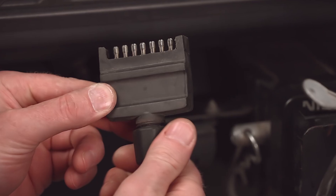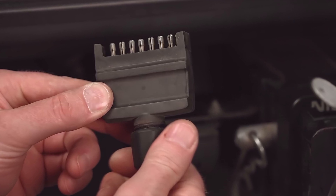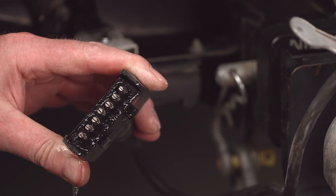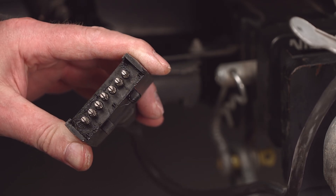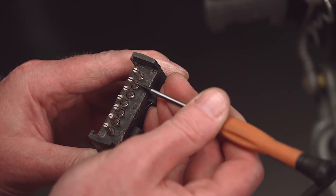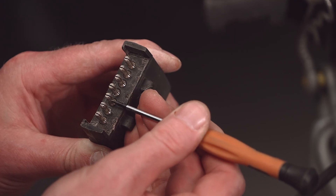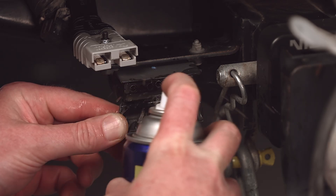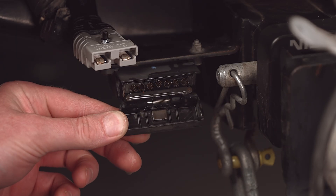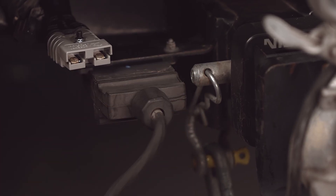First, this poor connection could be caused by dirty, corroded or under-tensioned pins on the trailer plug and base. Ensure your trailer plug pins are clean and not bent inwards. Use a contact cleaner such as RP7 or WD40 to clean the pins if dirty or corroded, and a small flat blade screwdriver can be used to straighten any bent pins. Be careful while doing this as the pins break quite easily. Finally, give the trailer base a quick clean as you did with the plug. Reconnect the trailer plug to the vehicle and check to see if the fault code is still being displayed.